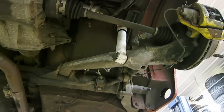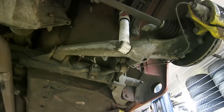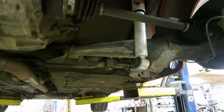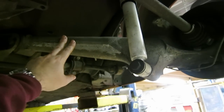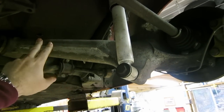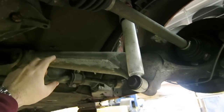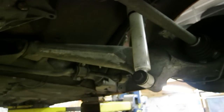Someone asked me to explain the rear suspension of the 944, so I'll try to do that now. This is an '84 but it has '86 control arms on it. These are the rear control arms and they are cast aluminum. The early cars, the pre-85-and-a-half cars, have a stamped steel and welded piece here, but it serves the same function.